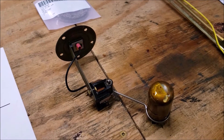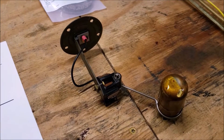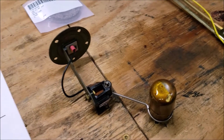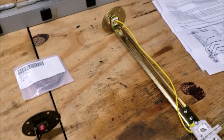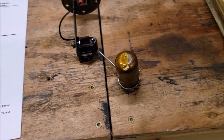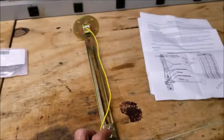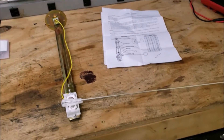I ended up finding out through searching, after trying to install a similar fuel level sender that I had upgraded in my MEP 802 Alpha — those won't work. Apparently the new standard is like 240 ohm to 30 ohm. This is a 0 to 30 ohm — that's an old GM type. So I found this universal type one on eBay for 28 bucks, and as you can tell, it's enormous.